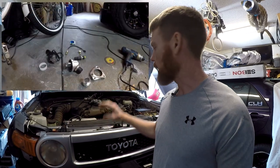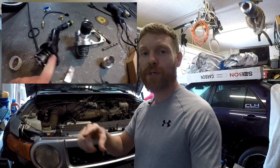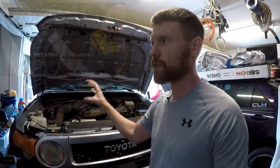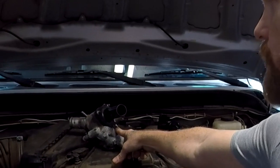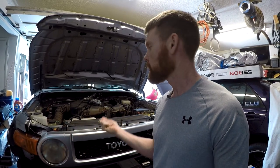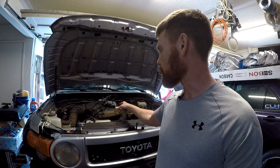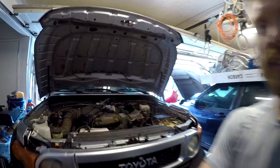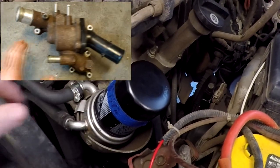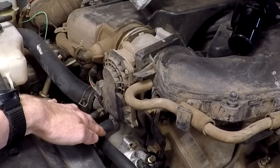The Toyota one is still fiber-reinforced plastic, and at the end of the day it crumbles after about 15 years depending on your environment. For that reason I actually custom made my own billet thermostat housing. This same install video applies to 2005 to 2015 Toyota Tacomas with the 4.0 liter V6 — also known as the 1GR engine — which is what's in this FJ Cruiser. I have the upper water pump inlet from the Tacoma on this engine because that's a tow package upgrade I did last year.